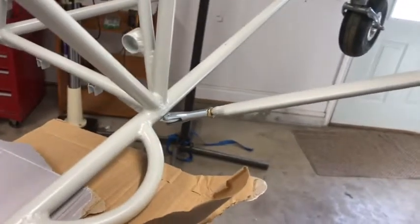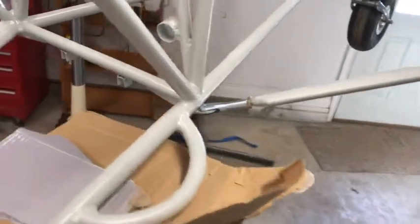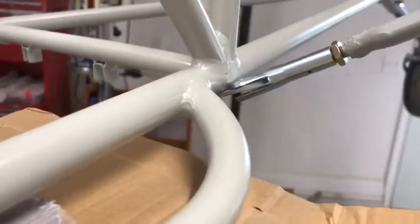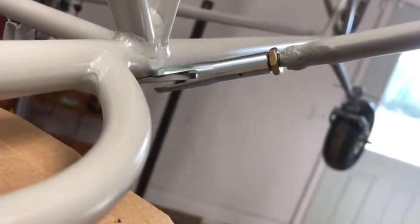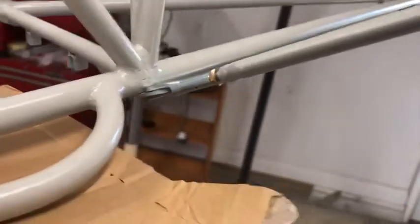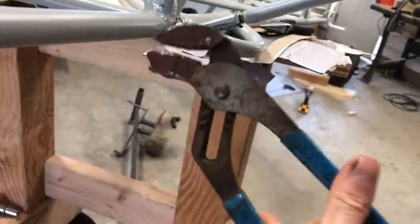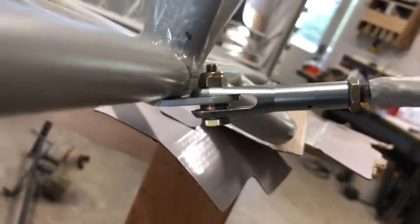The next thing to attach is your struts, which start with a clevis and a stop nut — an AN-4, I believe — and then attach up at the front of the horizontal stabilizers with another bolt. This may not line up perfectly. Your tab off the fuselage and your clevis fork are at a bit of an angle. I was surprised at how easy you can bend that. All I did was wrap some electrical tape around a wrench like this and just give it a little tug, and I slowly moved it into position until it matched up perfectly.